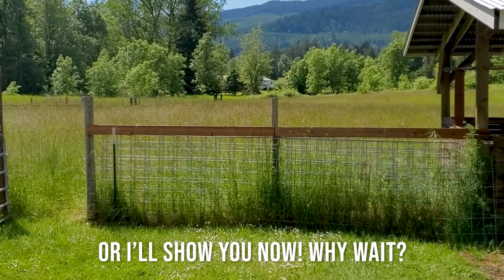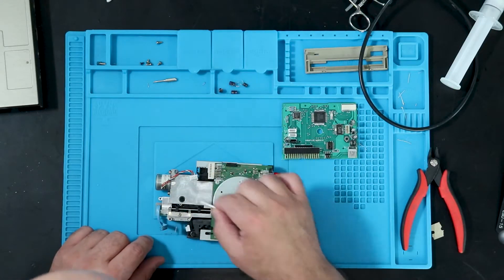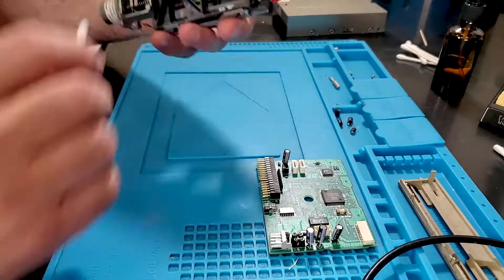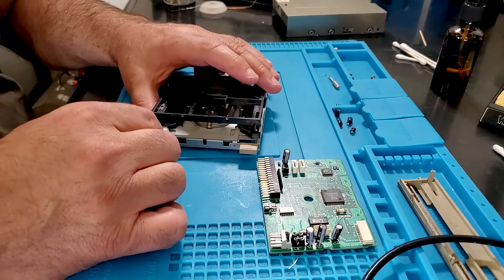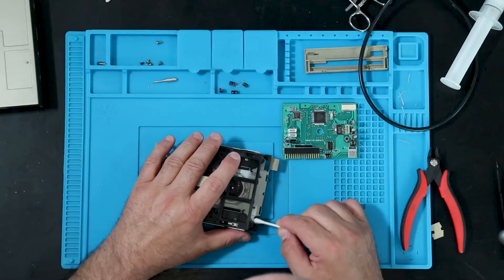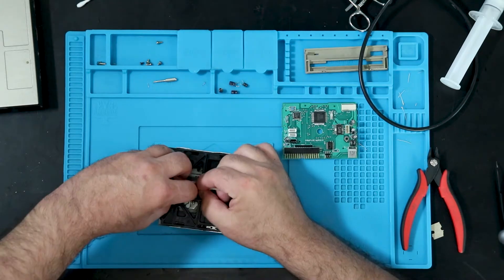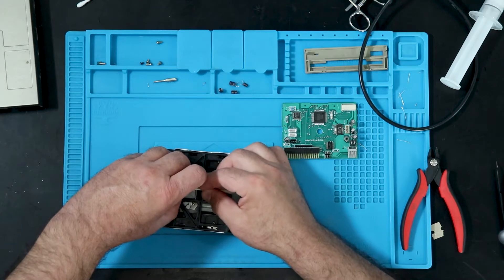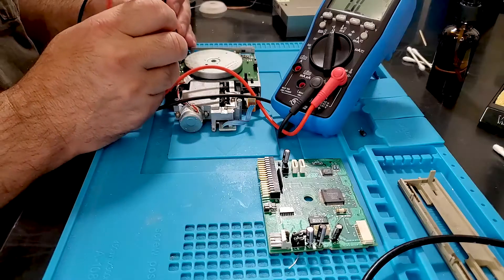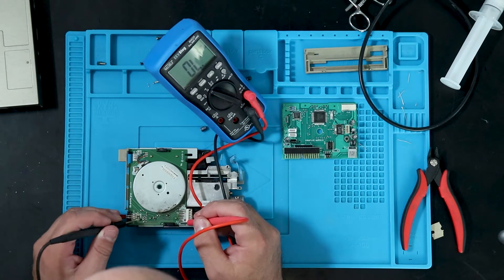My eye is just watering — I'll show you what it looks like outside my shop so you'll understand why. The mechanism got cleaned really well using cotton swabs and alcohol, being careful not to leave little fuzzies behind. Then I added a little Deoxit D5 into the floppy detect switches — a common issue nowadays, though we never had problems with them back in the day. Cleaning the heads is just the same as back in the day: a Q-tip and alcohol, clean them really well, get the crusties off but be careful not to damage them. I also pulled out my meter and checked the traces on the motor board — everything seemed just fine.